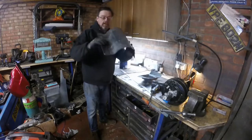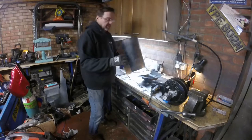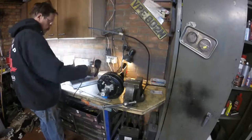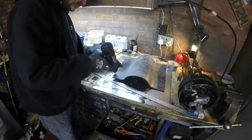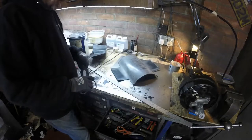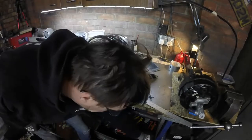Not bad - so there we have a curve. I just need to make a similar one on the other side. When the thing cools down it stiffens up quite quickly. One thing to note: when the board is hot it cuts and bends easily, but when it's not hot and you try to cut a big piece, it becomes quite a lot harder and sometimes splits.